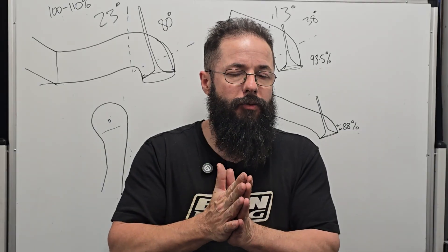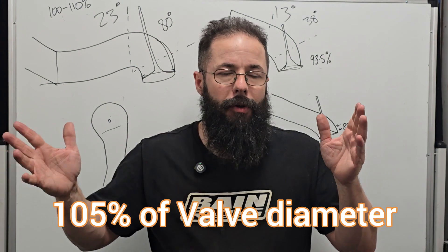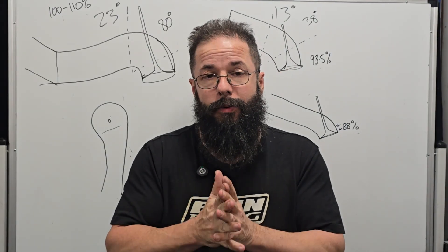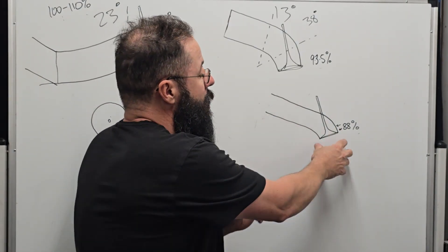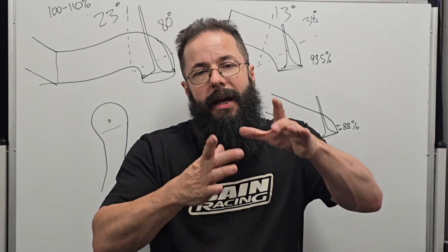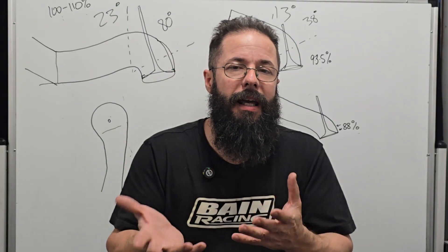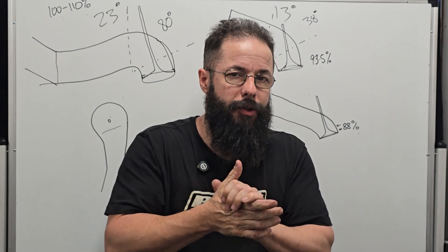This is why I don't like hard and fast rules like 'your bowl needs to be 105.' In twin cams, we definitely don't want big bowls because they kill inertia. A twin cam port with an 88 throat — we want to mimic that seat diameter into the bowl. We don't want the bowl any bigger than it needs to be. We want to morph the shape for the short turn depending on how severe it is. More modern heads don't really have a short turn, so you'll find almost parallel flow through there or a slight growth towards the window.